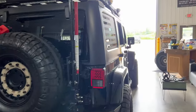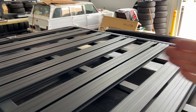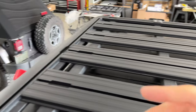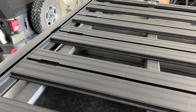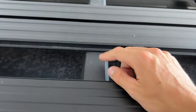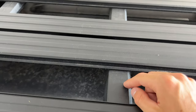When we go to mount this on the pioneer platform, we actually do not need to put any set of crossbars going horizontally because the distance between the crossbars on the tent are 28 inches. If you are running the pioneer platform on your vehicle, the distance between the crossbars will fit perfectly in between the pioneer platform and you're actually going to mount the tent to the horizontal crossbar.